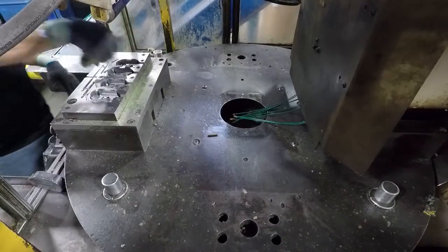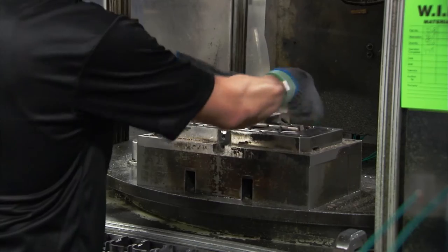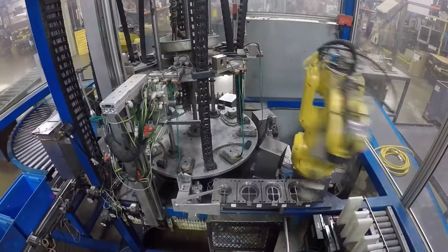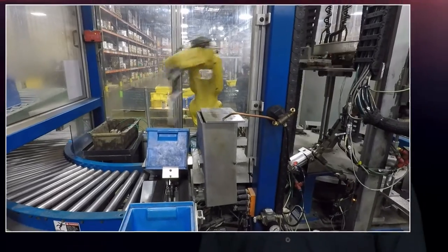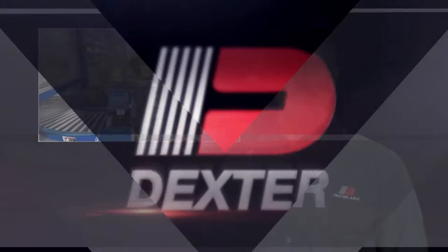Each magnet undergoes a three-stage grinding process, before experiencing a 100% robotic QC test that verifies internal connectivity and amp draw. Our magnets are made to strict quality standards and are 100% tested. That means you can be confident that your Dexter brakes will never let you down.